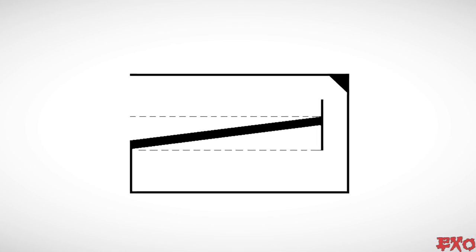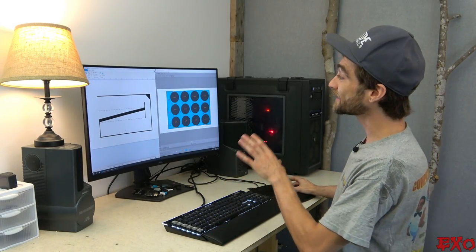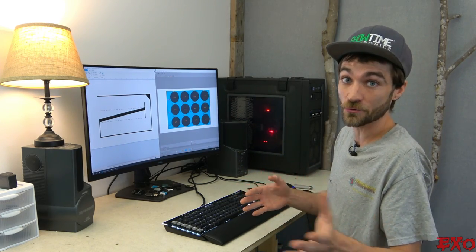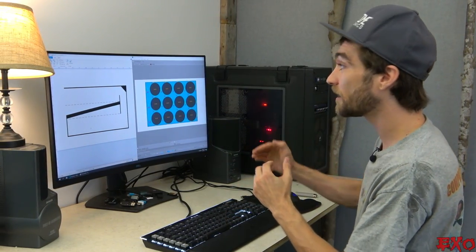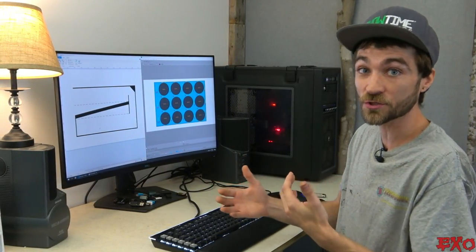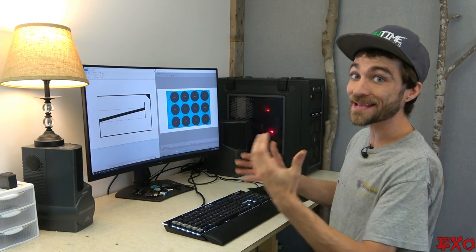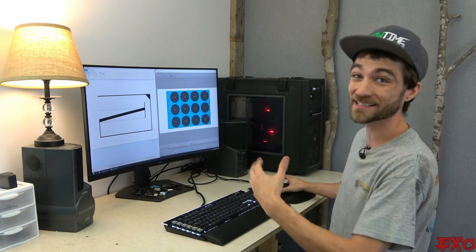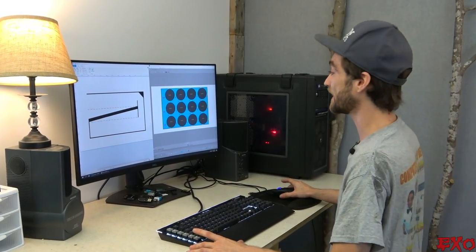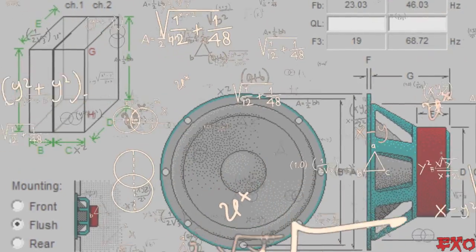For instance, this layout has such a long pathway, sonically speaking, that the tuning will be inherently low, the peaks may be too. So depending on how high the front chamber and the cabin can be tuned to once built, SPL above 40 Hertz may suffer as a result of resonant frequencies and certain distances not playing nicely together. Hopefully I'll be able to mitigate those symptoms with a little quarter wave combat of my own.